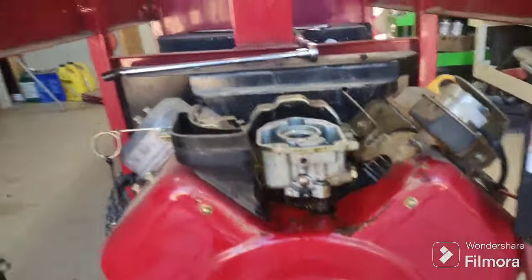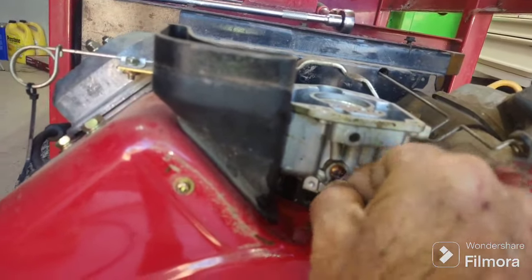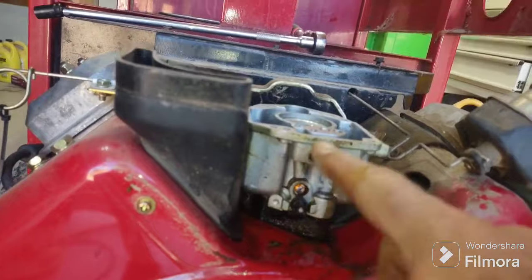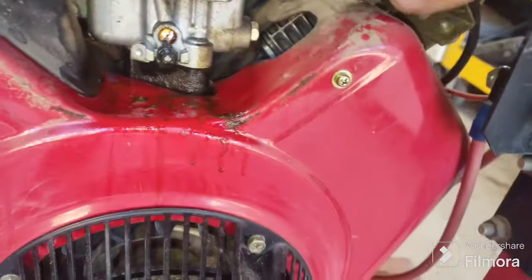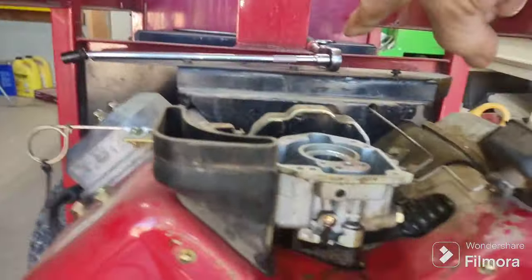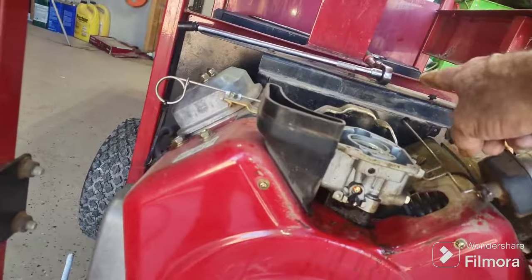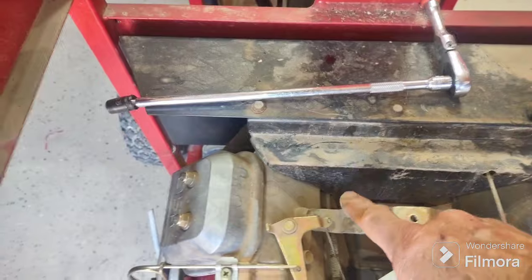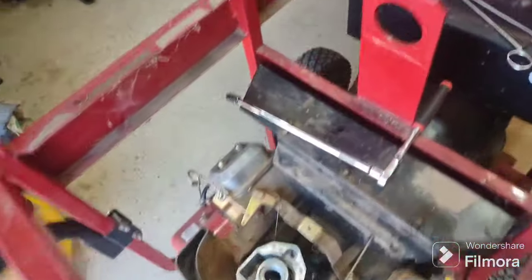Right below this Welch plug there's another little screw adjustment, but it has a limiter cap on it and it was right smack in the middle. Clean that, clean the jet, and then throw it all back together. I still don't know what that component is over here. I think I need to pull that cover — it makes sense that it would be connected to the governor, with some kind of linkage underneath that connects back to the throttle.